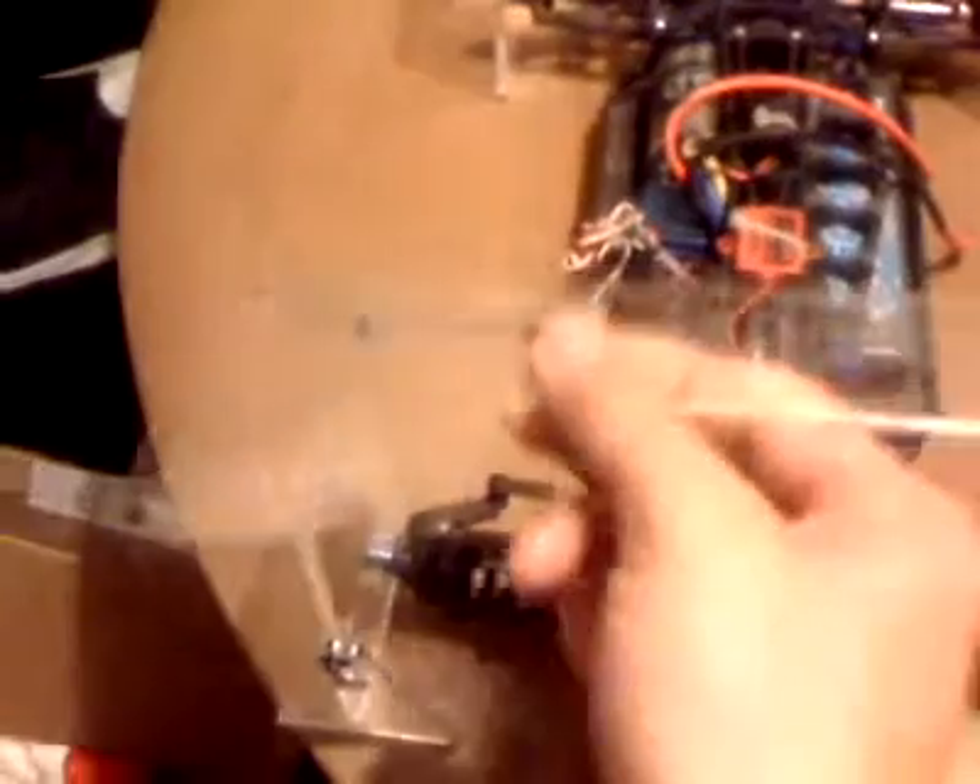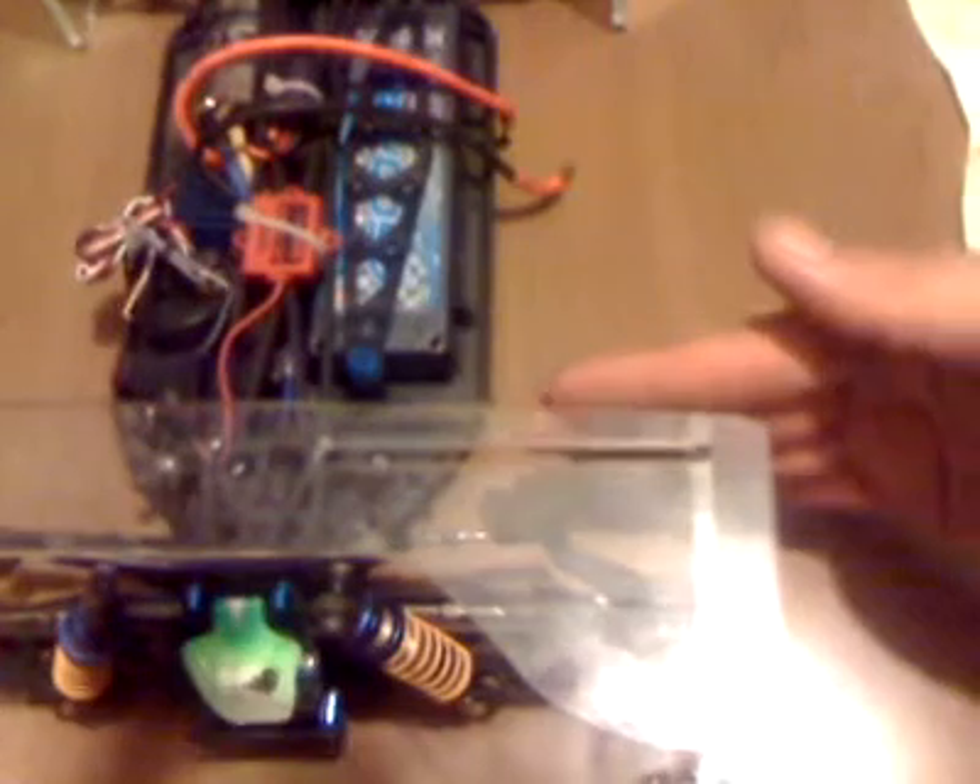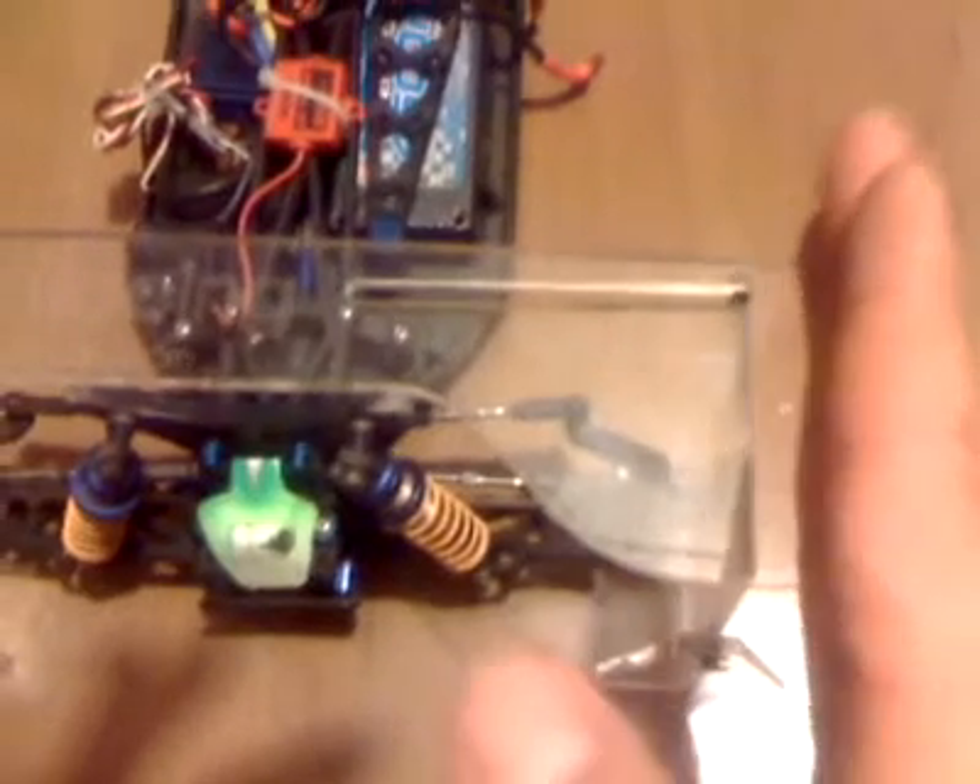The trick is to get it exact against the toe of the car, which you would use the sliding tool — which would tell you the toe of the vehicle. As you move the toe in or out, the setup jig will move in or out, and there are lines marking here with the degrees of the toe.